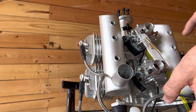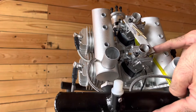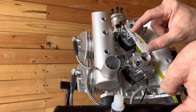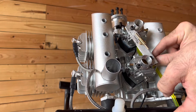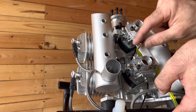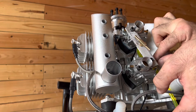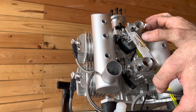That's going to allow me to work with my fuel ports over here on the side. You can see I've got a fuel port there and a fuel port there — I have to keep those equal in length. So I'll be able to measure those out, run those through, and try to keep them fairly equal in length. It'll allow me to move that around and create as short a distance as possible, keeping them the same length while shortening the distance.